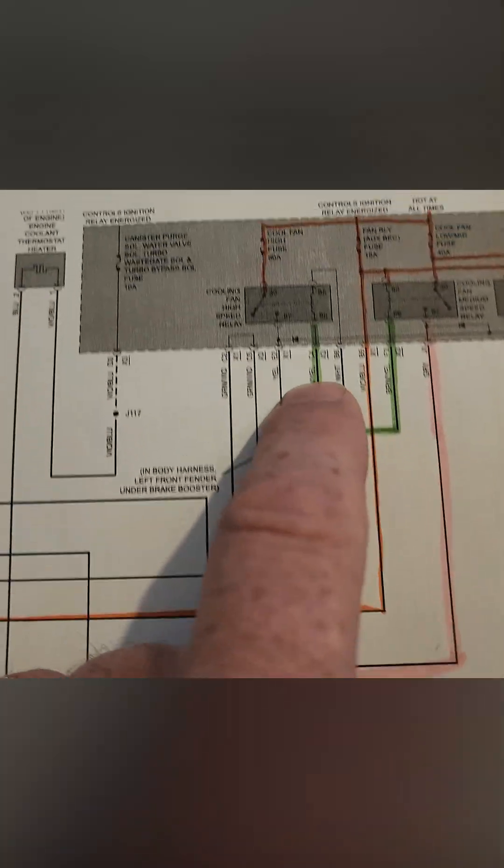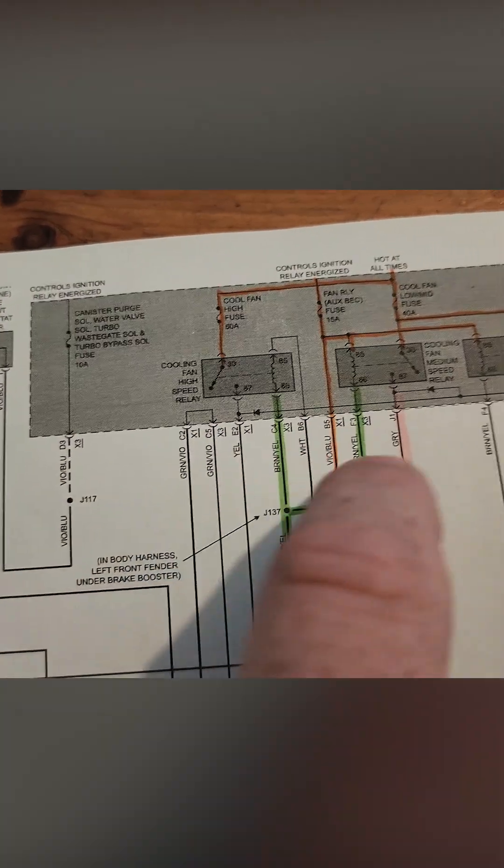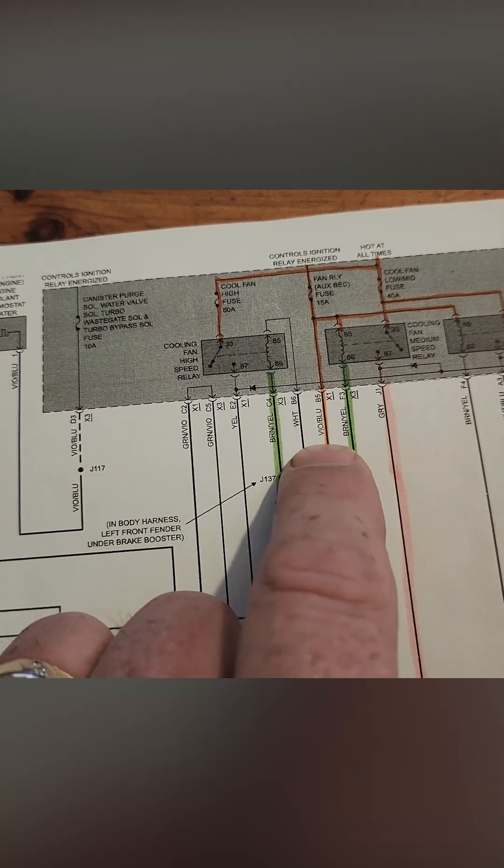Remember the drivers in the computer — they never tell us what's in there. How do we know what's in there? You follow the wire that doesn't go to the computer. Where does it go? Up to power — this is a ground side switch circuit.